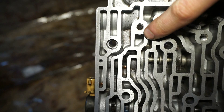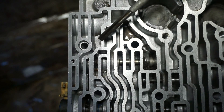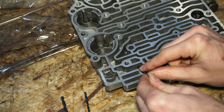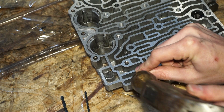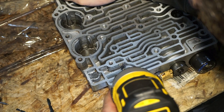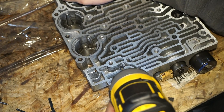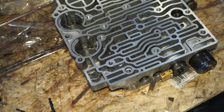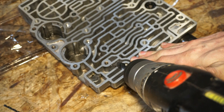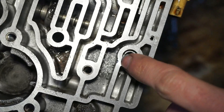So this section of the plate — we're looking at this hole. We're basically going to take this section right here and drill a hole. We're going to start with a 1/8th inch hole and then move up to 3/16ths. We'll start by doing a little center punch — I'm just using a nail, I'm not that fancy. To protect the valve body, I wrapped some tape around the bit. Now we're all the way through. I'll open it up to 3/16ths. Next I'm just going to go through and clean all the metal shavings out.